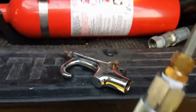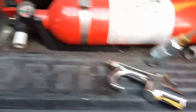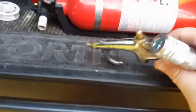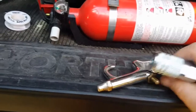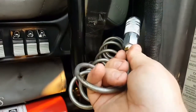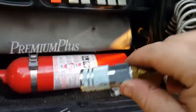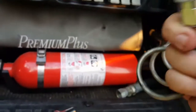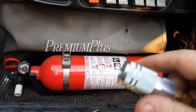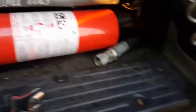Alright, it's all swapped out - it just screws right in there, no big deal. I benefit from this too - you put the other part of the quick connect in here and you can still use your blowgun. Usually this is the part that goes bad, so you can swap it out real easy. You can use tire chucks in there before and fill up tires at the house - it's kind of like onboard air. Pretty neat setup.